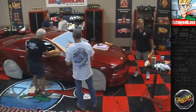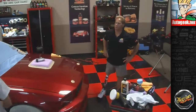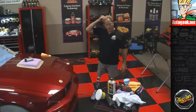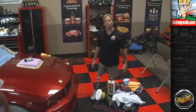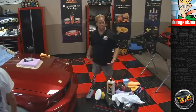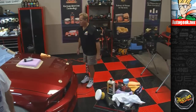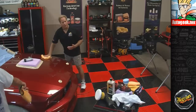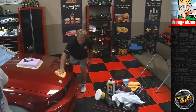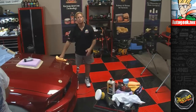I remember when 105 first came out, I was still working at Meguiar's when it first came out. In fact, I was there when 86 came out, 105, 205, a lot of really cool products. And I had a job buffing out 5 Mustangs for a car show, and 2 of them I wet sand, cut, and buff, and I used 105. It just came out, so I used 105 to pull all my sanding marks out. And compared to the compounds we were using back then, it was amazing how well you could finish out. Because if you use 105 properly, I mean, look at this. It looks like you used a polish.